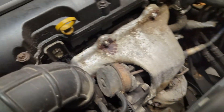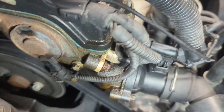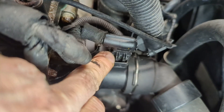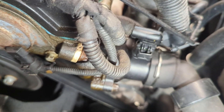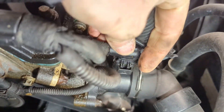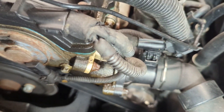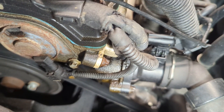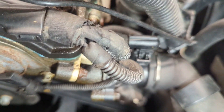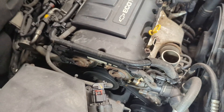I'm going to pop this hose out of the way to see if I can see anything obvious. There's the thermostat right there and the small connector. I don't see anything disconnected or loose and nothing looks chewed. This was an aftermarket thermostat — on the Cruze the thermostat comes as a complete housing with the thermostat inside, all plastic. It almost seems like this has failed again. Not very impressed — only 10 months.